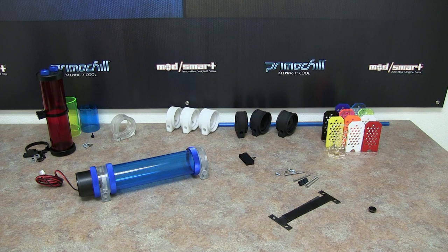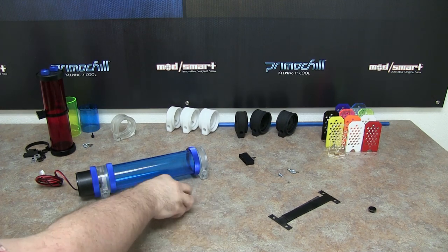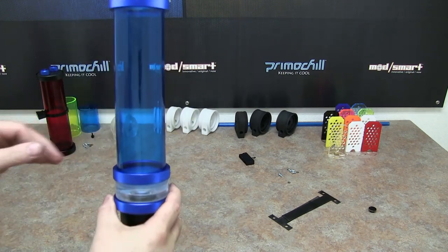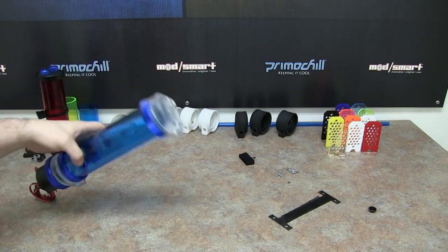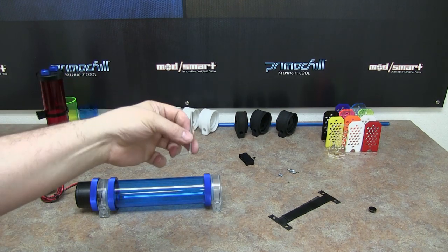One last thing: with all the testing we did — a lot of which is outside of cases on our wet benches — when we went to install this we noticed there's not going to be a ton of room once you mount this up against the back of your case. So we decided to include some M4 screws, which are about 70mm long, and a standoff. You're going to mount through the back of your case, screw the standoff all the way down to hold the screw in place. Bring it down about halfway, screw it into the back, and then cinch up from the back of the case to set your depth. This will give you about a two and a half inch standoff from the back of your case.